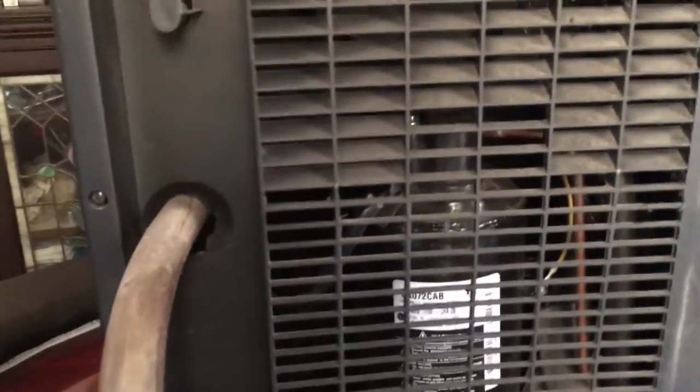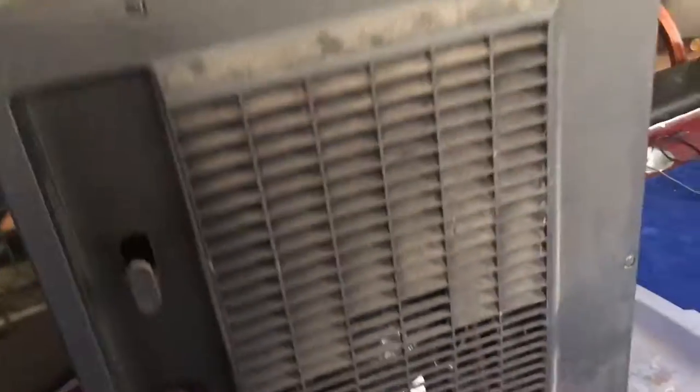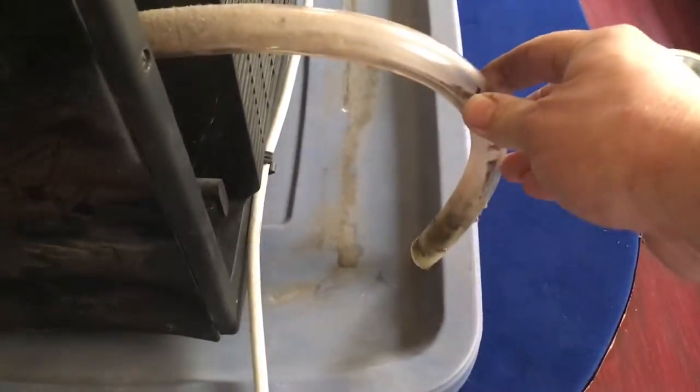You might be asking why am I using this on the dehumidifier - well because that's all a dehumidifier truly is, is an air conditioner where the cold coil runs right in front of the heating coil in order to remove moisture from the air. Its whole sole purpose in life is to dehumidify. I've also modified this - you'll notice I have a tube running out the back which goes into a condensate pump, so I can let this thing run and never have to worry about emptying the bucket.